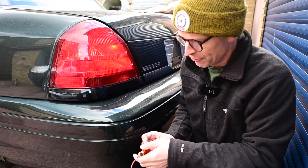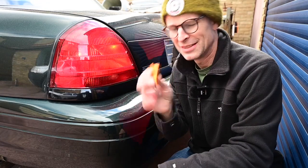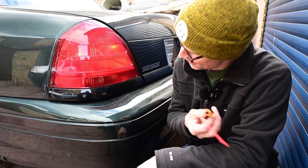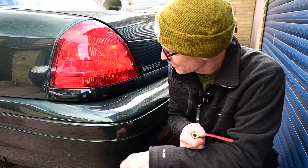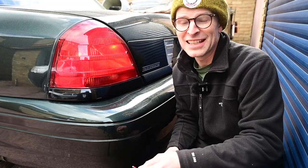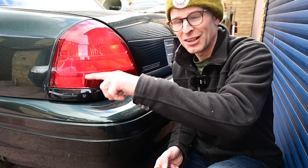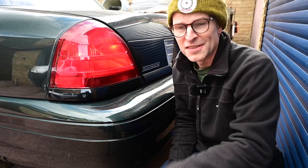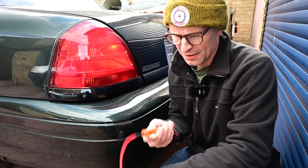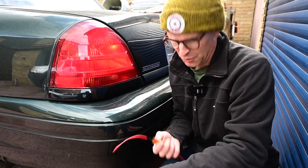That is running a little bit fast. I did buy some of these Amazon resistors specifically for this purpose and they've made next to no difference. So what I will do in order to get a little bit slower is get an old-fashioned incandescent bulb and include it in the circuit inside the boot, so it'll flash inside the boot and that'll just put a bit of resistance in the circuit. Better than these things — that was not ten pounds well spent.